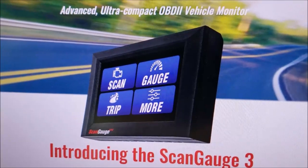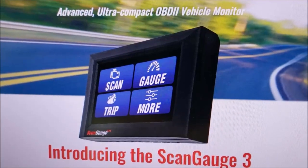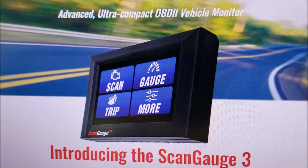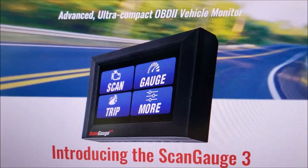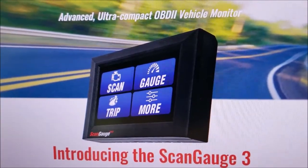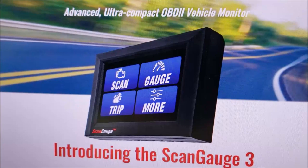Unless you own an 8.1 that has a Banks system installed — where they change the manifold and exhaust, and it flows a little bit more air — they will tend to run a little bit higher fuel trim on long-term. You could see 12 or 15, which could be considered normal with a Banks system. But if you've got a stock Workhorse chassis with 8.1 Vortec, you should normally be seeing about three or four percent on both long-term and short-term fuel trims.